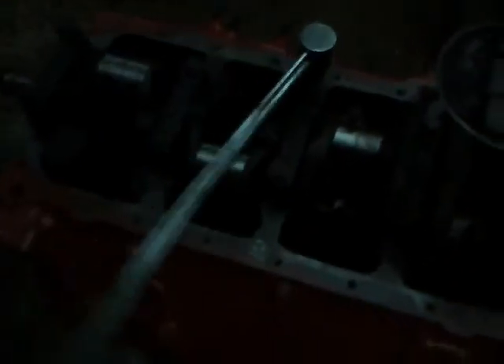That looks like 65 — about. And then the other one, same thing over here. These are called the main cap bolts. Okay, these are both tightened, so now we just directly loosen it. Also, this torque value says the bolt is supposed to be lubricated with oil, so we're supposed to dip the threads in oil before we tighten them. I had done that earlier, but for people out there — just don't forget.